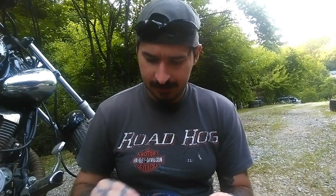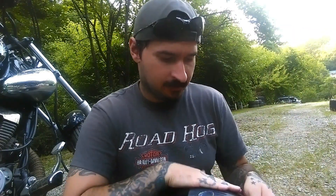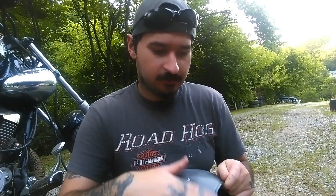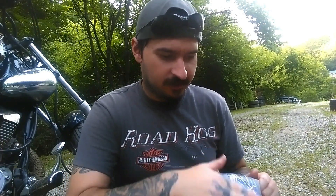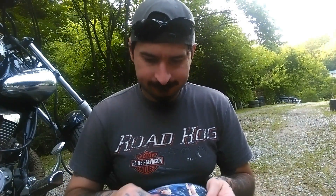I like 320 but when you're dealing with just a quick coat, 400 is kind of the go-to, especially on a DA, but you don't want to use a DA on something like this — you want to do it by hand. Out of all my choices, if I had a red scotch brite on hand, that's the best thing. Take your red scotch brite — don't take much, this is all we need — and scuff every bit of this you can get to. Since we are dealing with clear coat it will turn white and dingy. When you get it scuffed, just like so — you can see it. This opens the paint up so it can receive new paint and helps it bond; it does more than just put scratches in your paint, it's actually helping the paint bond with the new paint.